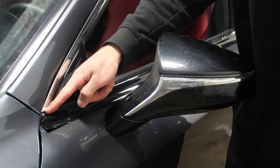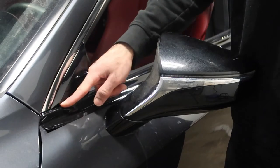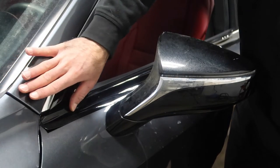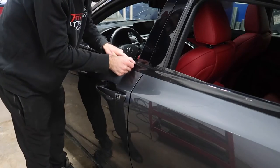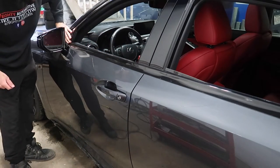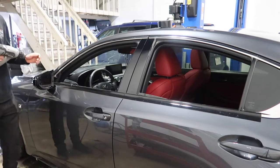I got the top part laid down, so I press all the way along the chrome and press the vinyl down on the top. Once the top is laid, I start laying down the middle — push my finger down and tack the vinyl down, making sure there are no wrinkles. You're more than welcome to use a squeegee or a wrap glove. Once it's all tacked down, we'll grab some heat, go over it, and then make our cuts from the front moving our way back.